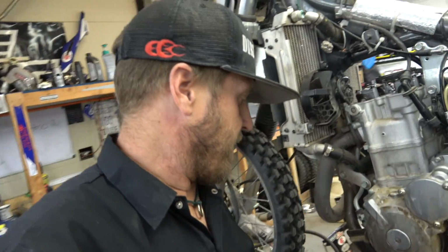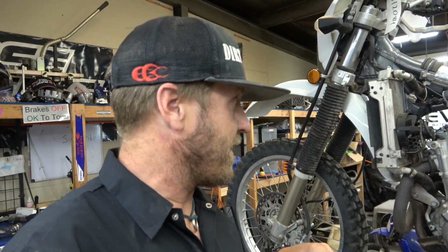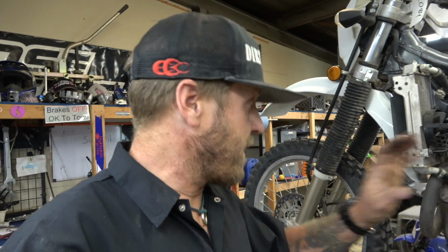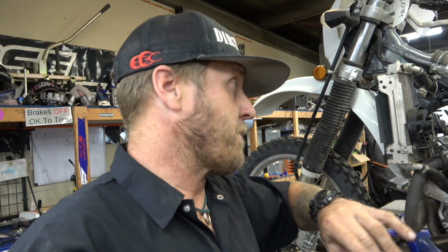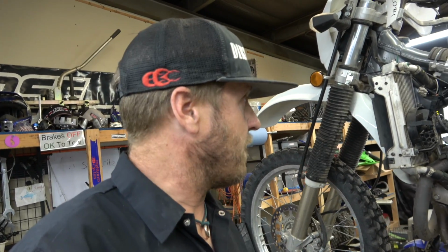And so yeah, I figured I'd drain it. And that could be why it's not making compression. It's got a whole bunch of gas running through the thing. The rings won't seal. So I'm going to start by draining the oil, putting the oil in it, and go from there. And it could be that the carburetor just super duper leaked forever anyway. So yeah, we'll give this thing a shot and maybe we'll get this thing running. That'd be cool. That is so good.